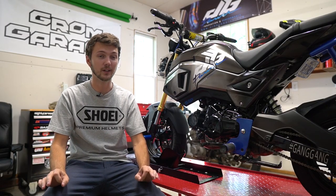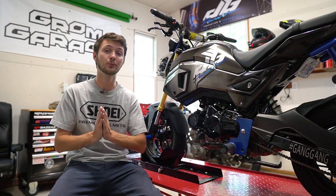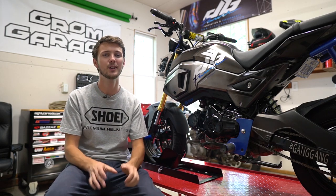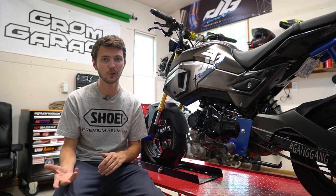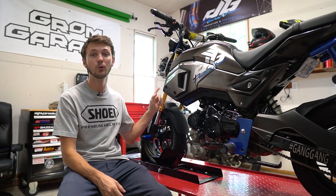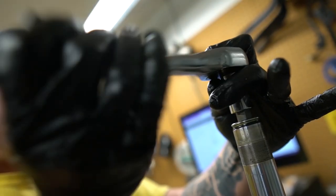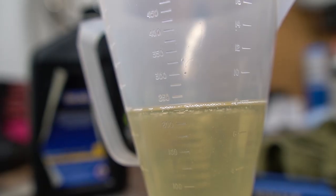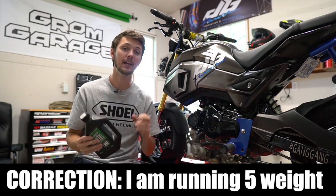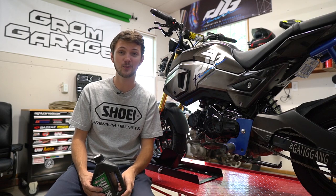The next one is a big one. The front forks on a stock Grom are just terrible, especially for wheelies and off-roading — you're going to bottom out constantly. A full Ohlins setup is stiff as hell, it literally hurts my wrists, so I went with an Ohlins spring drop-in kit from Hard Racing. It's like a $90 spring and spacer, and I put thicker oil in it — I'm running 10-weight oil with the springs. Highly recommend it, really nice. It's a little bit stiffer than a Z125 — and a Z125's forks are way better stock.